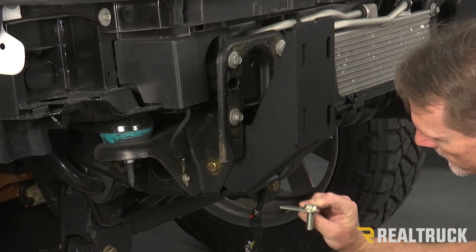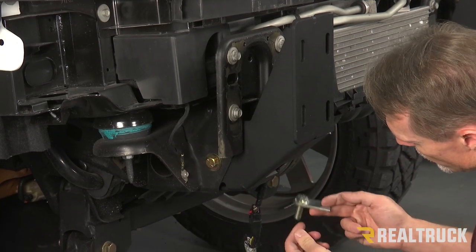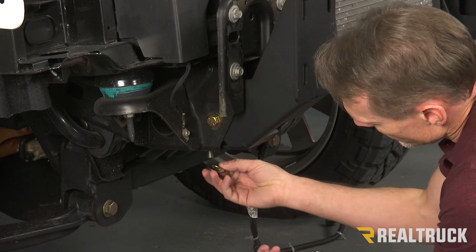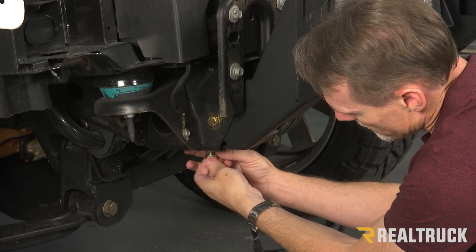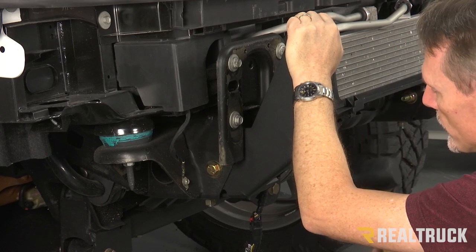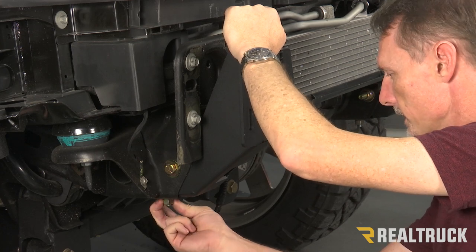Now what I need to do is attach this tab bolt. It has a small hole that comes down through the bottom and it's going to line up to the hole in the bracket. I'll drop that tab nut through the hole in the bracket and the hole in the frame horn, then attach a provided flat washer, lock washer, and nut — finger tight for now as well. Next, I'm going to mallet this bracket back as far as it can go and do the same on the opposite side to make both brackets even. Then I can tighten down with a three quarter inch wrench or ratchet, both the bolt in the bottom and the bolt in the side.